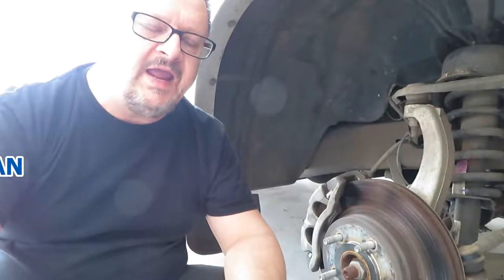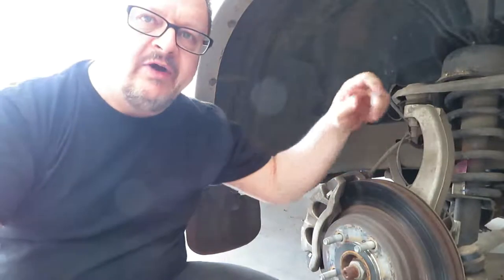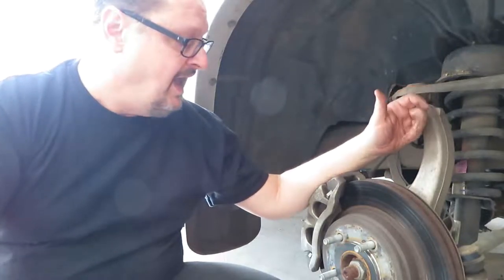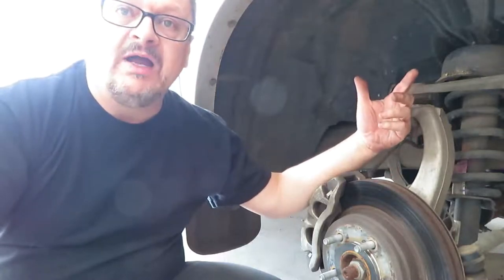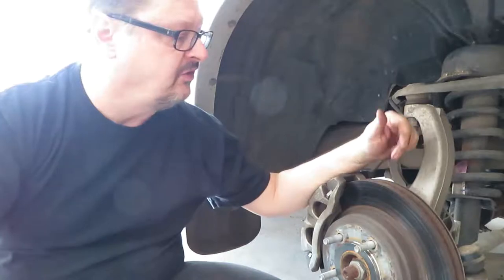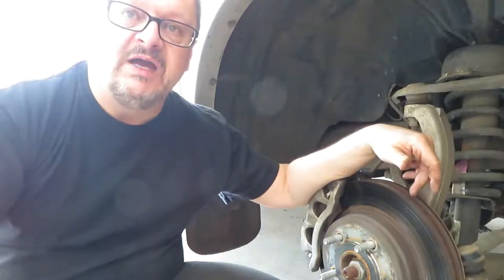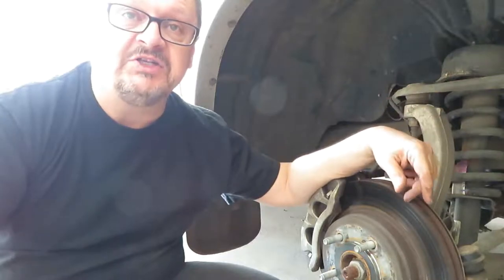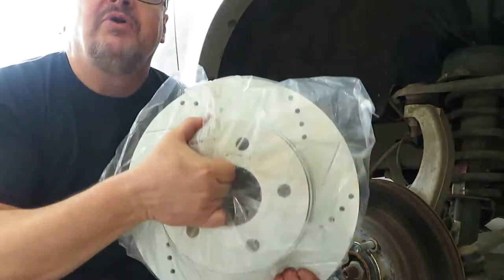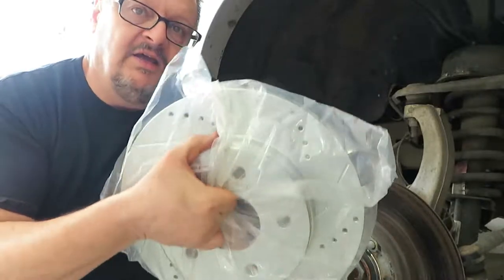Hello folks, Mundane Man here again. Today we are going to be changing out the pads and rotors on my 2012 Ram 1500 pickup truck. Unfortunately the brake pads and rotors aren't really worn out yet, but the rotors have warped. I think that's because I tow my quad and trailer behind the truck fairly often, and that weight pushing against the truck may have caused the brakes to heat up and warp. The maximum towing weight of a trailer without brakes is about a thousand pounds, and I think my quad and trailer is probably pushing that limitation. So what I'm going to do is actually upgrade the brakes a bit, putting on these vented and slotted rotors — that should help dissipate some of the heat.